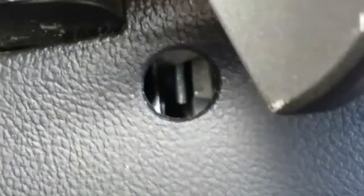That metal little prong there — you have to hit that with a flat head. Here's the flat head, and we'll just go ahead and hit it, and you'll see the airbag release. There's one in the middle, so we'll hit that one as well and release. Turn it through one more time — you see that one's right there — and release.